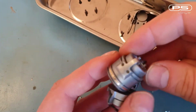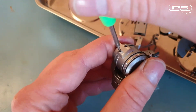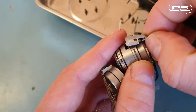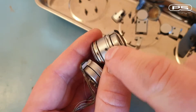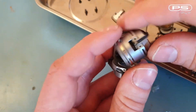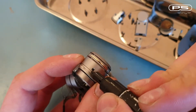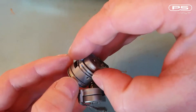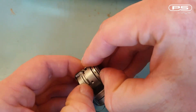Following where the cable goes, the second cover has a tricky hook on it and needs to slide off when removing. The cable leads us inside there now, where it would be connected to the CCD. Last two screws and we are in. I'll mark these two pieces with a marker pen somewhere on the edge to make sure they marry up exactly as they were when assembled. Now I can separate the camera from the gimbal using a small scalpel — gently pry it open, disconnect the cable and we are ready to install a new one.